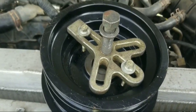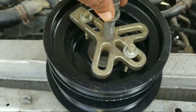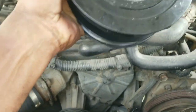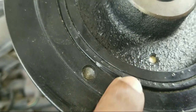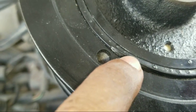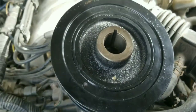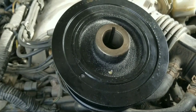Here we have the replacement crankshaft harmonic balancer pulley and this is the pulley tool — you'll be able to pick this up at the auto parts store. When I turn this over you can see right here there's rubber between these two rings. That's the rubber that becomes deteriorated and rots, and then these two rings will clash with each other causing that noise.